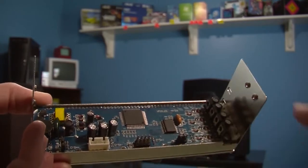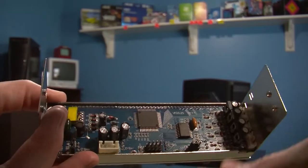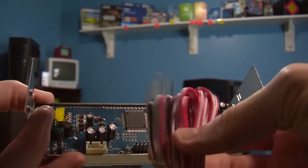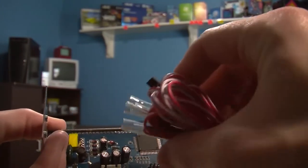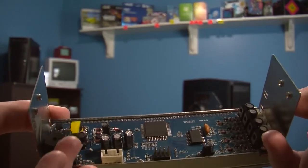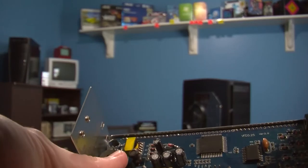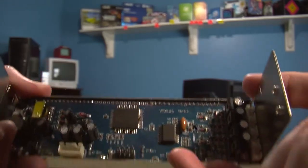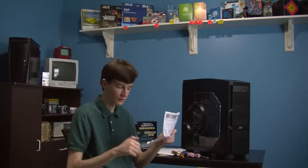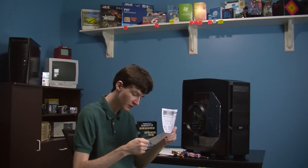These are temperature sensors — you can plug them into these little connections right here on the unit and stick the other end of the cable to various parts of your PC case to detect temperature. That's actually a cool thing. Here's the power connector, and then this is a jumper you can take out to turn off the beep from the speaker right there. This jumper switches between Celsius and Fahrenheit. The manual cautions: please do not place the temperature sensor between the CPU and the heat sink, as it would cause damage to the CPU or other installed devices.